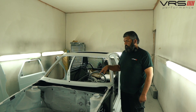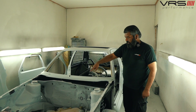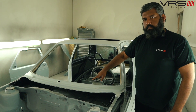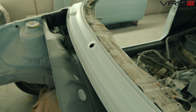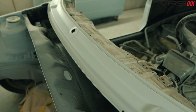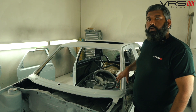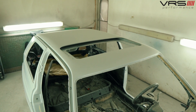I'll show you some detailed areas and then Axel will come in closer. Across the scuttle panel, this car normally has two wiper locations for a twin wiper setup. I didn't like the old double wiper setup, so we're going with a single wiper — this whole section has been smoothed out. There was also some rot in the corners of the windscreen, because these cars come with a bonded windscreen for added strength, so all of that area needs to be as good as possible before we bond a new screen in place.